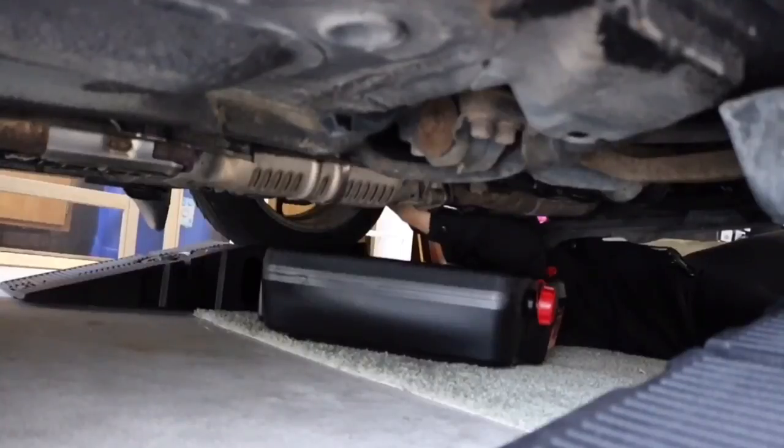As you can see, I am on the Honda now, doing the oil change on the daily. And you literally do the exact same thing. Take off the oil plug, let it drain. Take off the oil filter, let it drain. Put the plug back in, get the new oil filter and some of the new oil into the oil filter. Screw the oil filter back on. Put in your new oil and that's it. It's that simple.